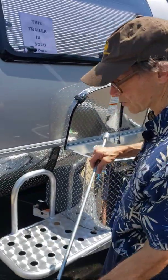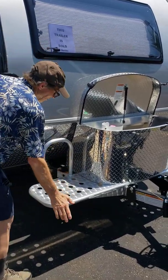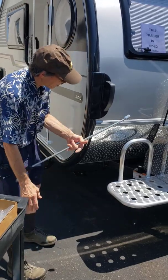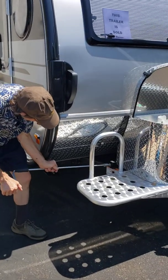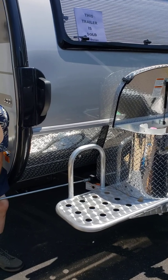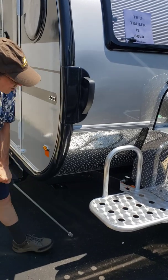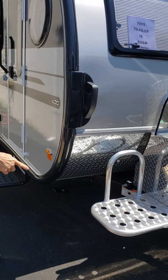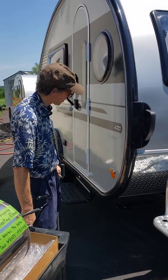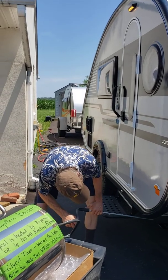This would be the stabilizer jack crank. Of course, we don't want to miss the fact that we have a nice platform here. It's a Boondock edition. You have your crank down spare tire. You can use this to crank it down. They also give you a very small handle for tightening it in the up position because there's a limitation of 300 inch-pounds. If you go a whole lot tighter, you'll strip out the gears on that spare tire. This then is your stabilizer jack crank.